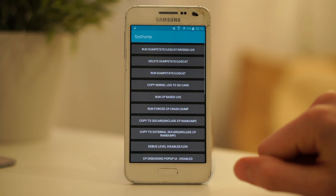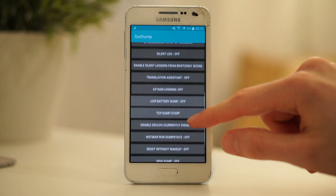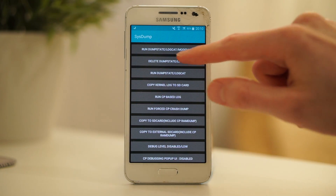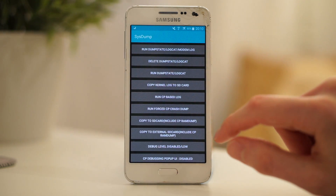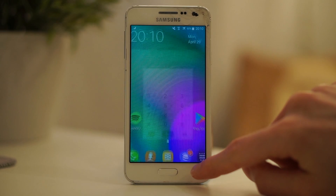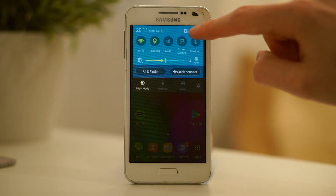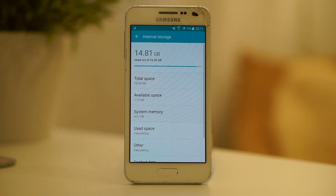If that didn't work for you, just skip the following part. In the hidden menu, you have a bunch of options. In our case, we want to hit the second option — this is going to delete some junk files on your smartphone. After you did that, click OK, scroll down, and hit Exit at the end of the menu, then go back to your home screen. Revisiting the storage section in settings, this method got some of my space back — I now have 1.19 GB free.